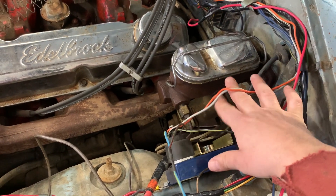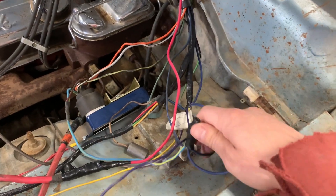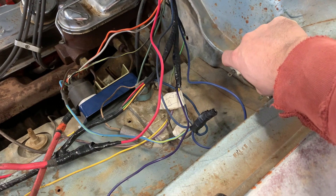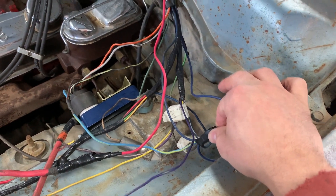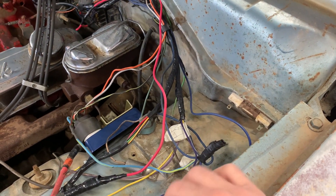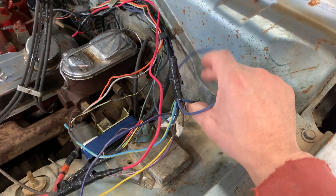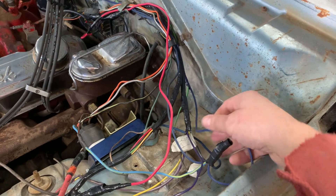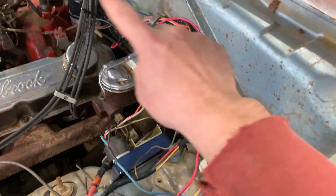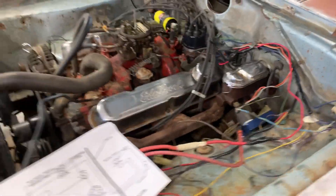So that's my five wires — pins two through five, and then power going to the ignition. For ignition one and two, I have those hooked together because that's the part that would normally route through the ballast resistor to limit power. I know this looks like a mess — the wiring harness needs to be replaced. This is just pieced together to get the car in and out of the garage until I get a proper harness. In this big bunch here we have ignition one and two from the ignition switch, hooked into the voltage regulator, and that also goes to the positive on the back of the alternator and to the positive of the coil.